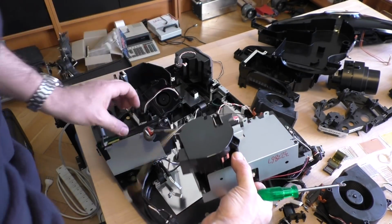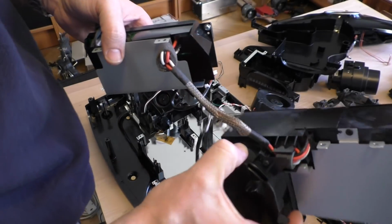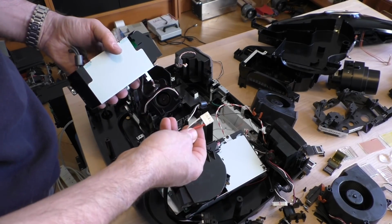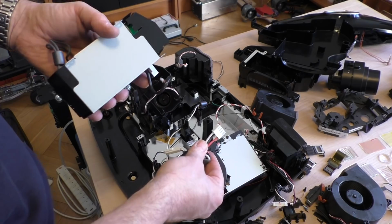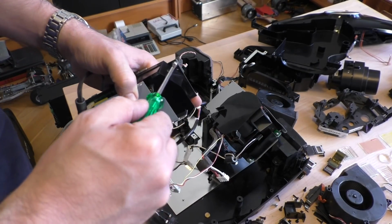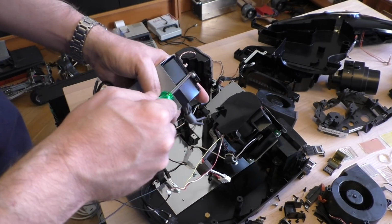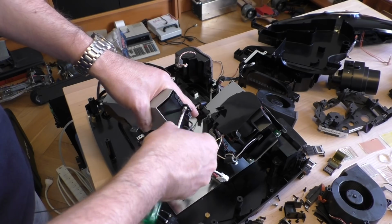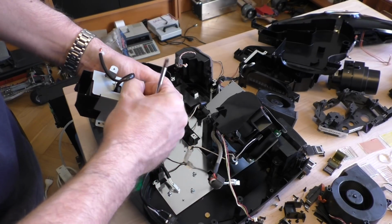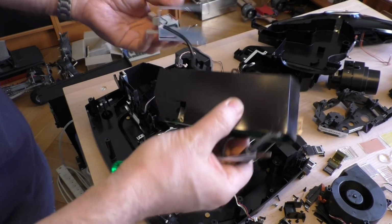Okay, now I see it. So that's, I think, the normal power supply here. And that's the lamp power supply. They can be disconnected. So that's probably a 300 volt DC, because the rectifier and the input capacitor is here, and that's only the part that regulates the current through the lamp and also provides the high voltage startup pulse. Maybe that's broken, I don't know. But the lamp was also old, and I think there was more than only one defect here.